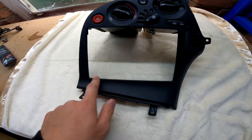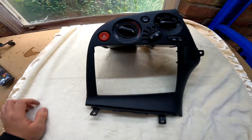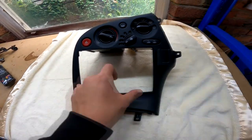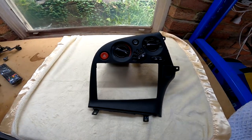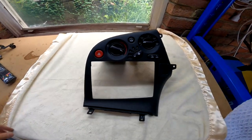The reason why I've had to take this fascia out to fit the head unit is because these edges will need to be trimmed back to fit the larger screen — in total about six millimeters wider and three millimeters taller. The head unit still hasn't arrived yet but I have the exact dimensions of the display, and since we've got nothing to do and we're in lockdown I thought might as well just send it.